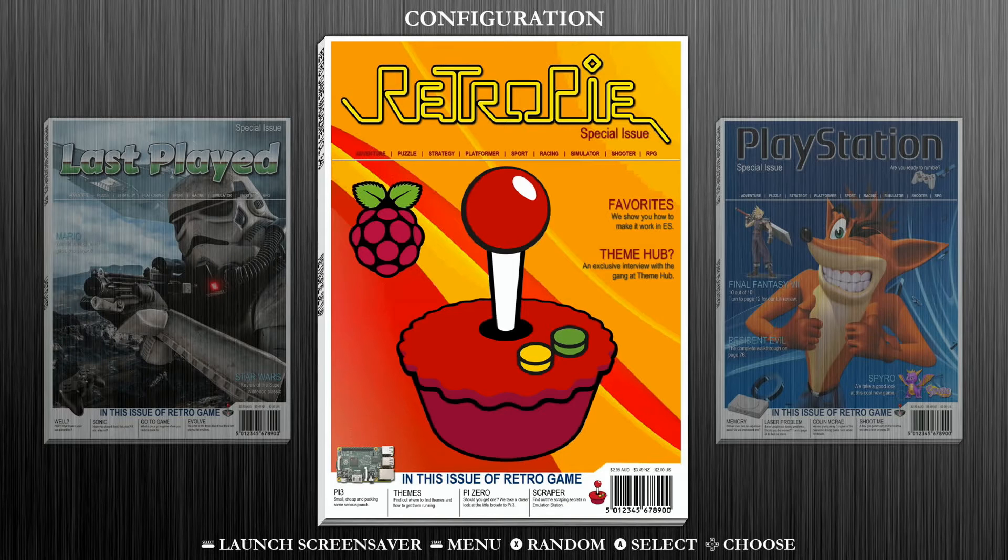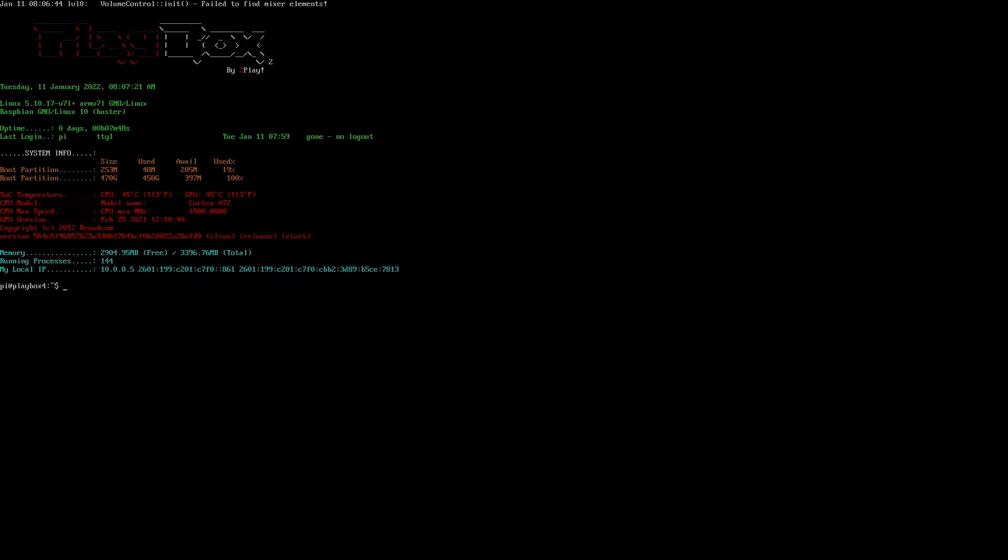Back all the way out to where you started. Next, on your keyboard, hit F4. Keep in mind that some keyboards assign dual functions to function keys — sometimes they're mapped to number buttons, and you'll need to hold the Function key (usually to the left of the spacebar) to activate them. Go ahead and hit F4 and that's going to open up your command line. Your command line may look different than mine — mine says Play Box, yours might say Raspberry Pi or RetroPie — but it functions exactly the same.